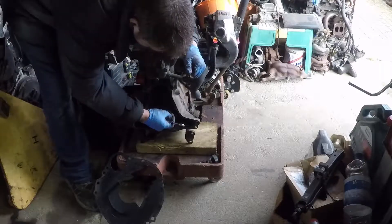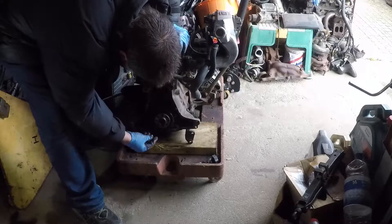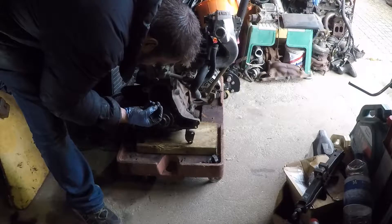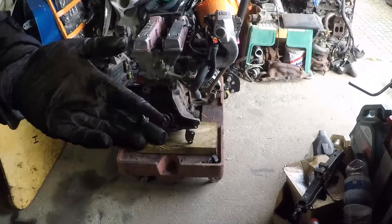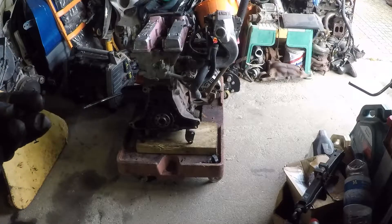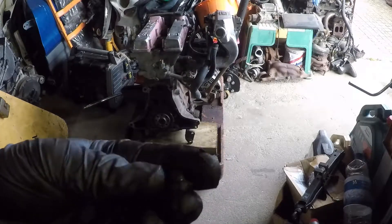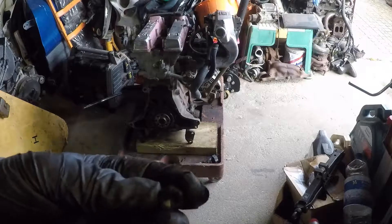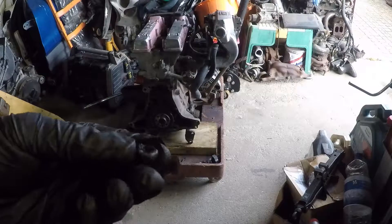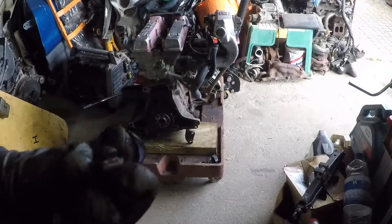Remember: bolts back in holes. We thought we were a bolt short on the flywheel, and I could see the end of a bolt was snapped off inside the flywheel — snapped off from the clutch cover into the flywheel. I didn't expect that someone would have actually left that in there. You can see it's got really, really marred up from being sat underneath there.